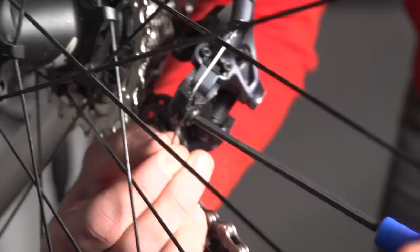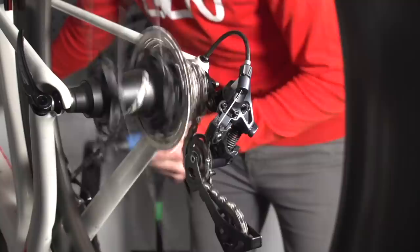Second question: I recently got myself a new shiny gold chain. After putting it on and fine-tuning the gearing on the 105 5800 groupset, the shifting is perfectly smooth, but not when the chain is on one of the two smallest sprockets on the cassette — it jumps up a little bit as if there is a bump on the cogs. Firstly, make sure the gear hanger is nice and straight, because it could be playing havoc with those last two sprockets. Also make sure the inner cable isn't kinked or bent, which might prevent the derailleur moving into the perfect position. Check for stiff links in the chain by running it slowly backwards and looking carefully.